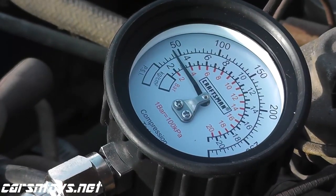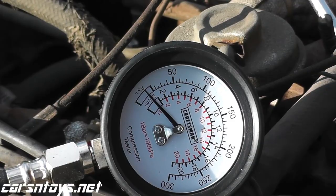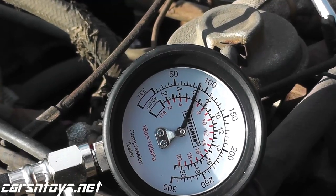If you do this on your Subaru or any vehicle and the pressure is low, you can add just a little bit of engine oil into the spark plug opening and try the compression test again. If the pressure increases, that's indicative of bad or worn piston rings. If nothing changes but you still have low pressure, then most likely it's something within the valve. You can get a pretty decent idea of what's going on just by doing a compression test. I have owned this vehicle for almost 10 years, placed over 100,000 miles on it, and always maintained it over that time. It's really important to take care of your vehicle — it lasts a long time and you save a bundle of money in the process. At this point I'm just going to install the spark plugs and wrap it up for the day. As always, thank you for watching.